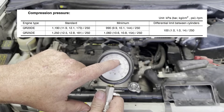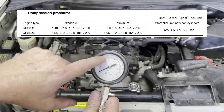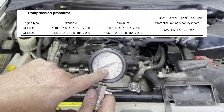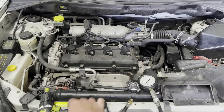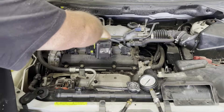We're looking for around about 170 to 180 psi — those are the black numbers on the gauge. If you use kilograms per centimetre squared, we're looking at around 12.1, which is what the specs tell me. But obviously we can't do anything until these coils and plugs come out.